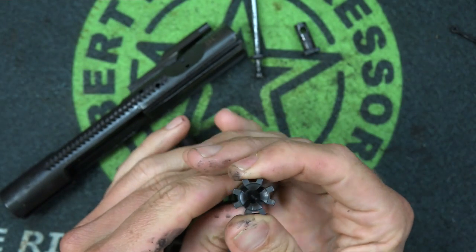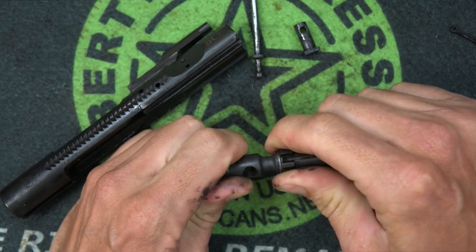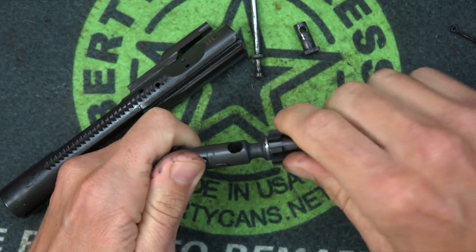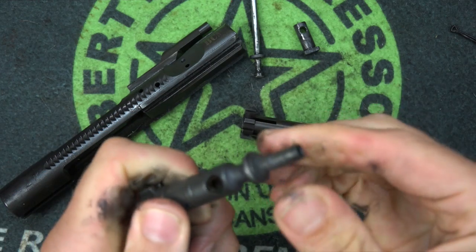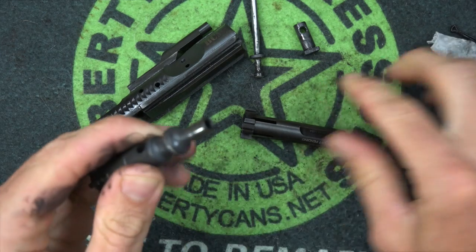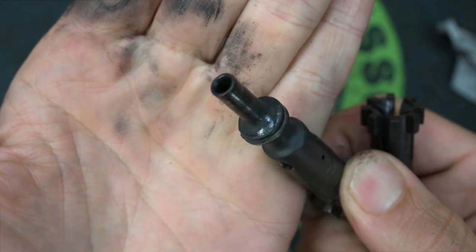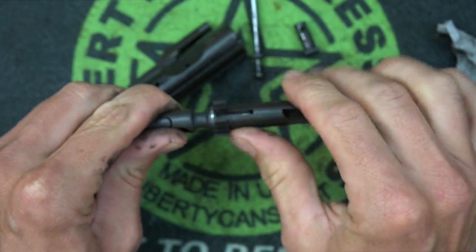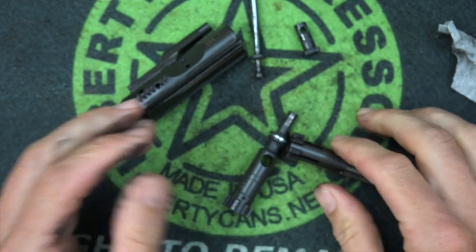What's nice about this product is that you can squeeze it in and rotate it, basically changing the pressure point just a touch. You can hear it still grinding — that's really what you want to do. We're going to get down to where you're starting to show some metal, because you don't want it so tight that it's going to wear your finish off. You can see how it's focusing in and just getting that carbon off and starting to get almost perfectly clean. I'm putting pressure laterally on it, causing it to impact the tail of the bolt at a different place. That's how that part works.